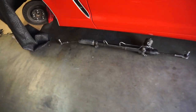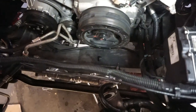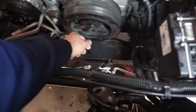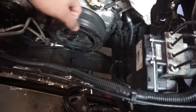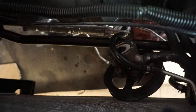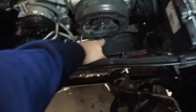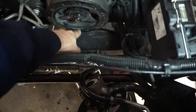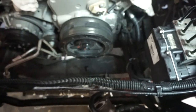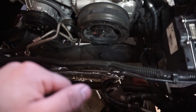That took way longer than expected. As you can see, the steering rack is out. I know some people actually leave it in the car and just move it to the side, but since this is my first time I need all the room I can get. Now we've got the crank pulley wide open and accessible. I'm going to take the bolt out, then put the puller on it, pull the crank pulley off, and then we can take this timing chain cover off. I took all the lines off — I highly doubt I needed to do that, but it just felt easier. This bolt should be torqued to like 250 foot-pounds, so you're going to need a better air gun or impact gun that can hopefully take that off, or somehow lock the motor to get some force on it.